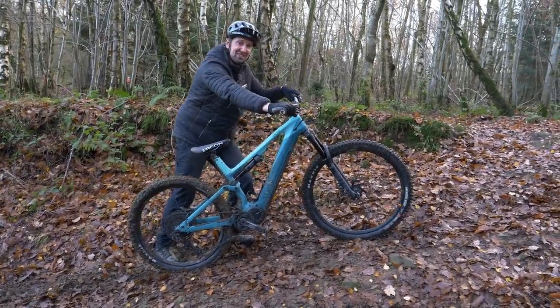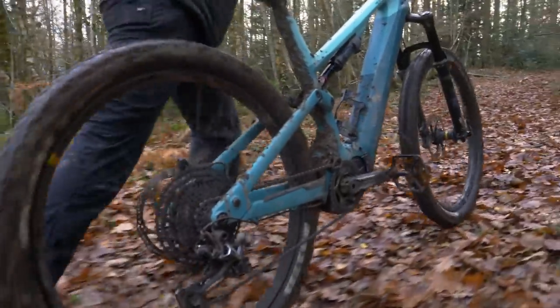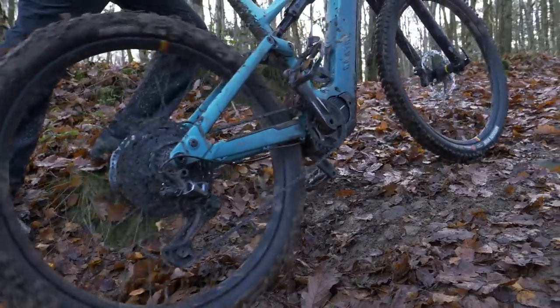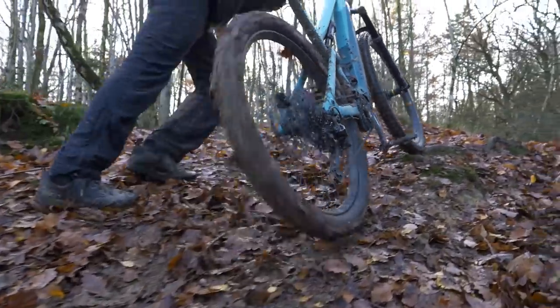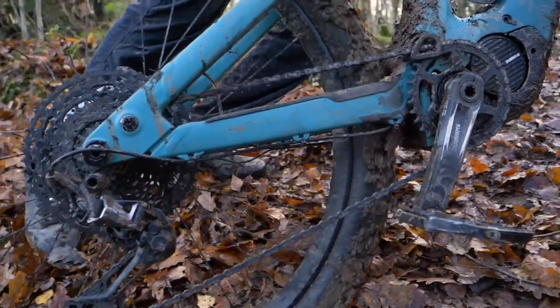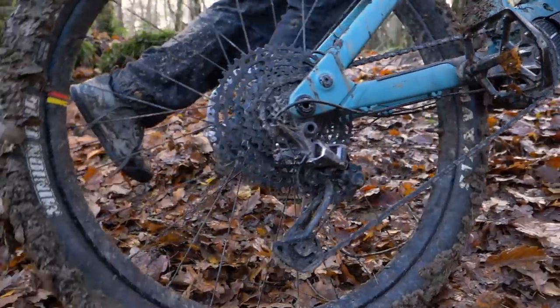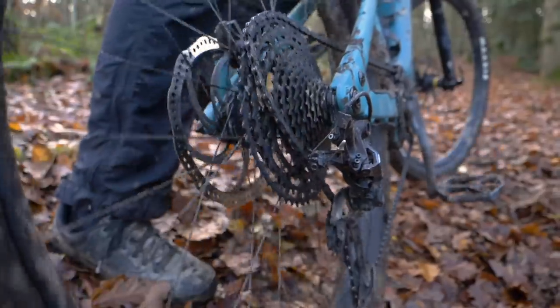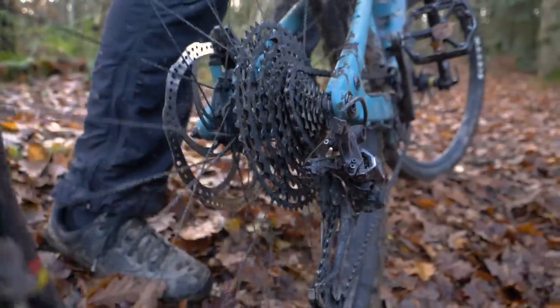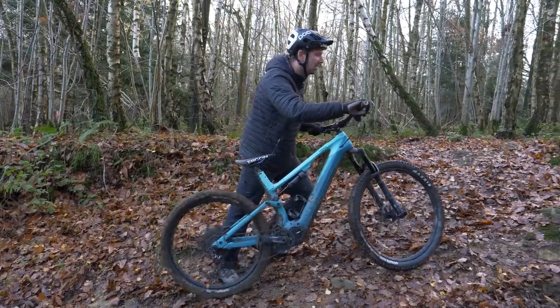You can of course use walk mode for its intended purpose — getting you and the bike to the top of a climb. All you need to do is scroll down, get walk mode engaged, and stand clear of your bike, because the cranks will actually spin when you engage walk mode and the bike will go up the hill automatically. If you're not feeling much punch from the motor, try knocking it down a few gears to the middle of the cassette for more power to the top of the climb.